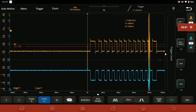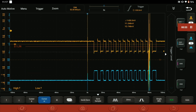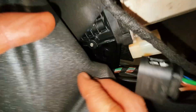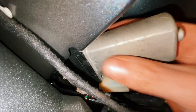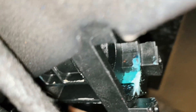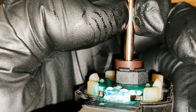I promised I'd show you the motor - there's a visual clue every time, even if you don't have any tools, a scope, or even a multimeter. Instead of taking all the window regulator off, because it's tensioned under a lot of pressure, just pull the motor out - three screws at the back. It's a worm thread, so you don't have to disconnect the window regulator motor from the regulator and all the cable will spin out. There we see instantly - corrosion that shouldn't be there. It's got a seal on it; it shouldn't have any corrosion whatsoever. Let's take a closer look at the circuit board and see exactly what's wrong with it.